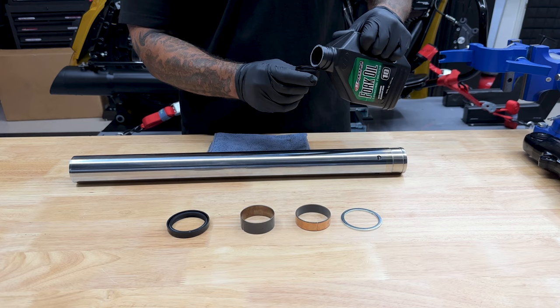The torque value for these pin screws is 14 to 18 foot-pounds. It's not going to be completely lined up all the way around — just make sure you get both sides as equal as possible.